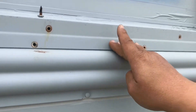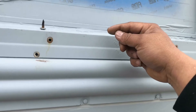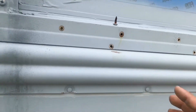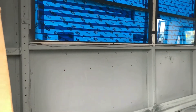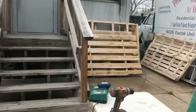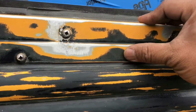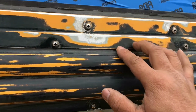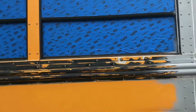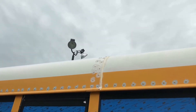The other issue I have is where the aluminum folds — there's a nice gap in between, and on the other side of the bus if you push on that gap you can feel an air pocket. Sometimes if you have a small enough lip, water will actually travel upwards slightly, build up, and that's the problem I was having on the inside along that wall. I was still getting water, and I think that day the rain was coming from the driver's side of the bus, which is why I took in so much water. You can see how the gap allows water to build up, travel upward a little bit more, and then get into the bus. That's one of my leak issues I'm addressing.